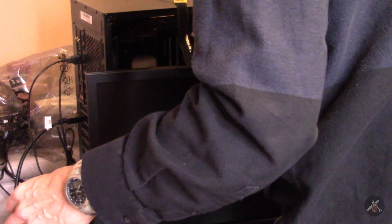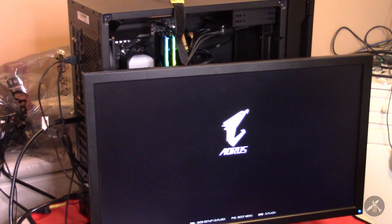Let's see if we can make this thing go. I've got a mouse, a keyboard, an operating system, and a hard drive I'm going to use to get us rolling. What I've done at this point is brought my hard drive over from my old computer that has Windows 10 on it and plugged it into one of the SATA ports on the motherboard.